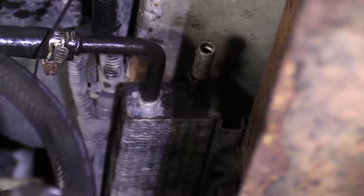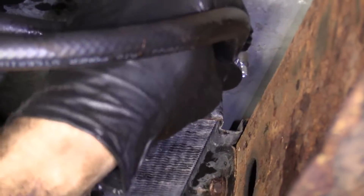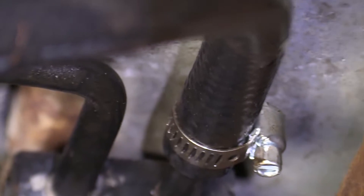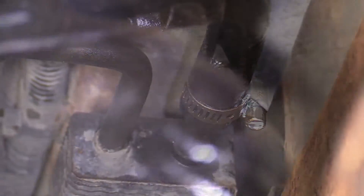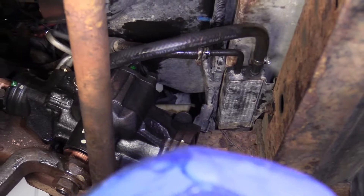Let's move along and grab the other hose — just put it right on here. Give it a nice push; that one bottomed right out. Get our clamp on there and slide it. You'll notice I didn't put the clamp all the way down at the end — you want to leave just a little bit of hose at the end, but make sure you still have plenty of metal going through. The metal comes all the way up to pretty much where my thumb ends, so we're clamping onto metal. Nice tug — that feels really great. They're nice and tight.